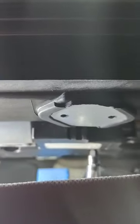And just to show you, by turning the Allen key again in the center of the black portion of the motor, we were able to close the sunroof to smooth position. Customer does not want to replace the motor assembly due to cost.